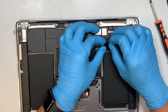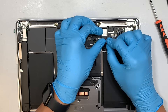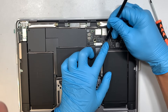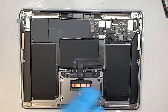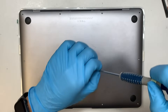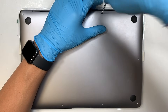Last but not least, you see that little flex metal clip — make sure it's open, push the battery connector back in, then close it with the clip by pushing it down. If you don't have a fingernail, just use a plastic prying tool to push it down and that will fasten the clip. Now press the back cover in right in the center where the clips are, and fasten with the Pentalobe P5 screwdriver.